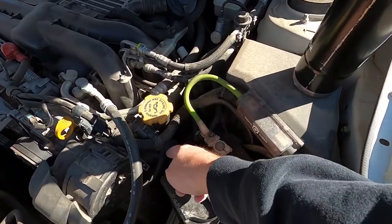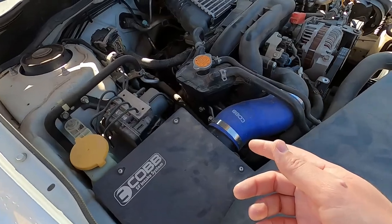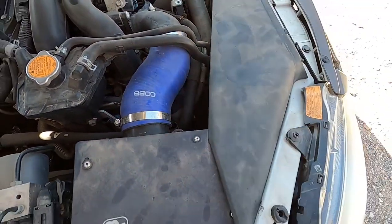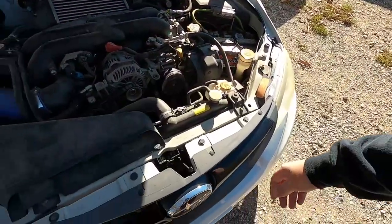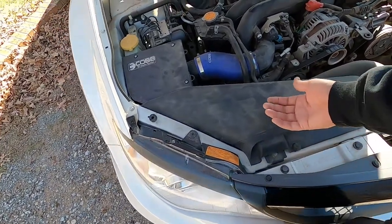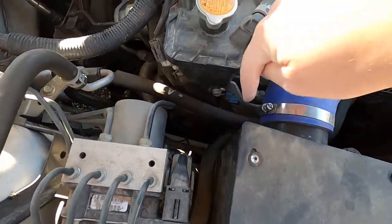On the driver side you got to take the battery out, take the air pump cover off just to get to the coil packs — and you're right there on the frame rail. On this side you still got to deal with the frame rail but you've got a little more room. Cylinder three is down there, cylinder one is up here, pretty much right under this. So I'm gonna go get some tools — it's a crispy 43-44 degrees right now — and get it over with. I just need a screwdriver to pop these tabs, an Allen to get this off, and get my air box pulled out of the way. Then I'll pull the coil pack, see if the bolt is loose, pull the spark plug, and see what it looks like.